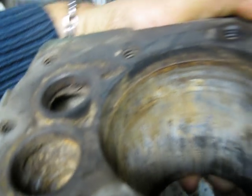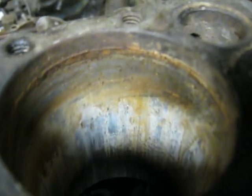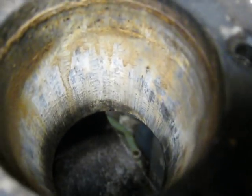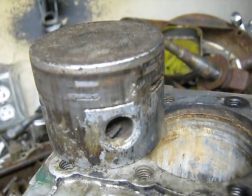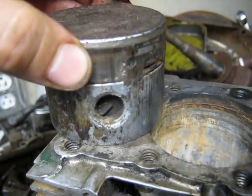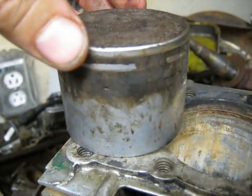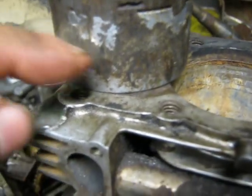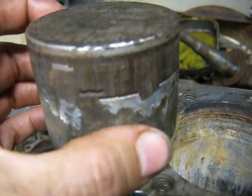There's a lot of corrosion, but it's sticking outward — it's not corroded in. I was worried maybe the piston rings would have kind of bored their way into the cylinder, but that didn't happen. Looking at the piston, you can see the piston pin on one side. The whole piston pin area is full of corrosion, and in this area you can't even see where the rings are.